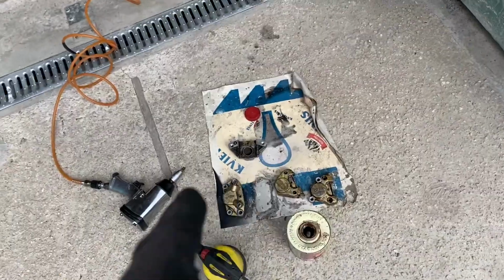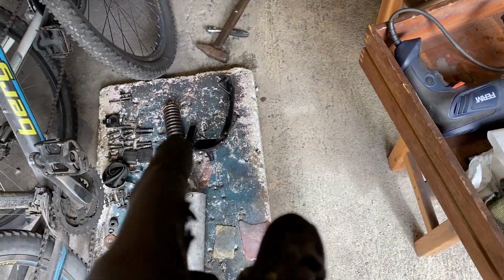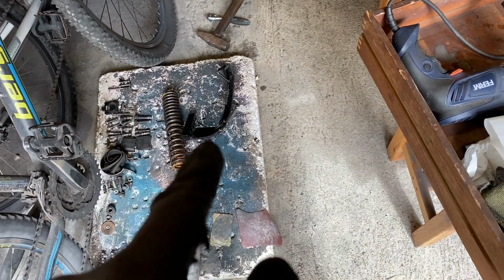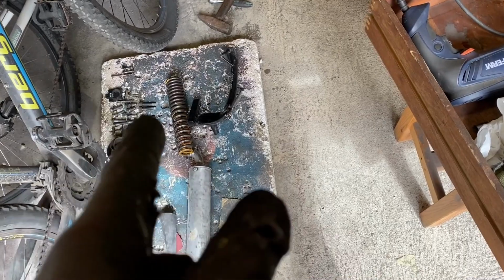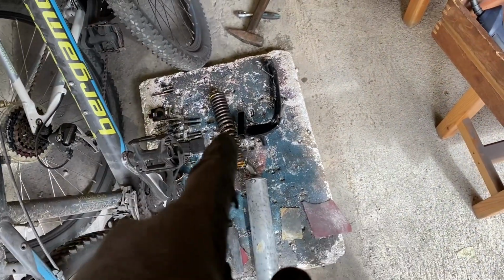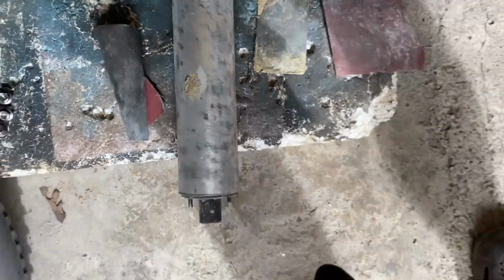That's that. What I decided about the Bizzetti side stand is that there's no point in repainting it because those areas are going to get worn down anyways, because those are the same areas that get used. What I did was I just removed the rust for right now, then I'm going to degrease it and prime it just so it doesn't rust over, and that's all I'm going to do with that. Still haven't decided what I'm going to do with the spring, and for this I put on a little bit more body filler because I just didn't fully fill it in yet.